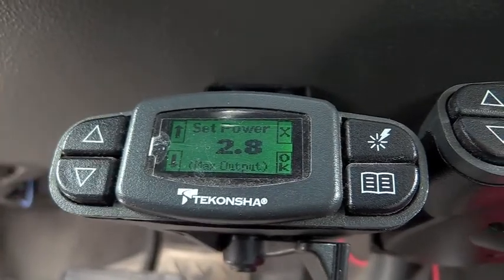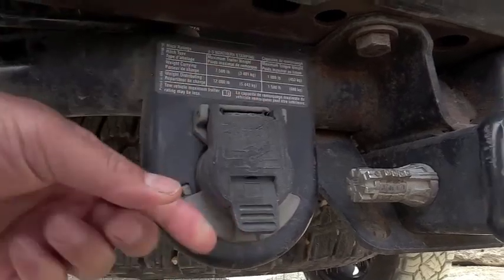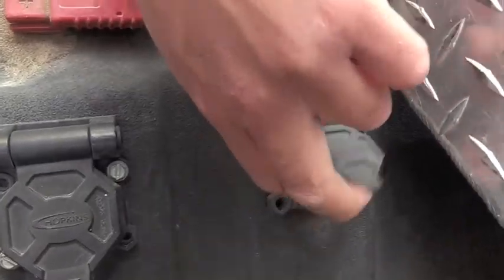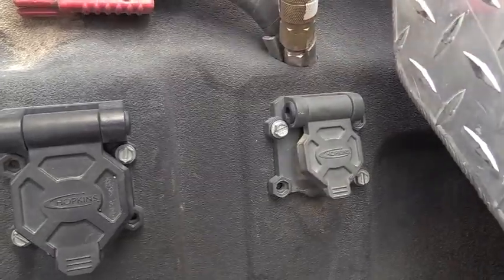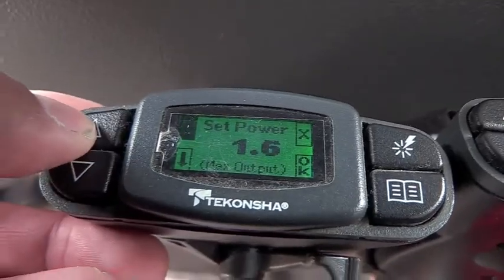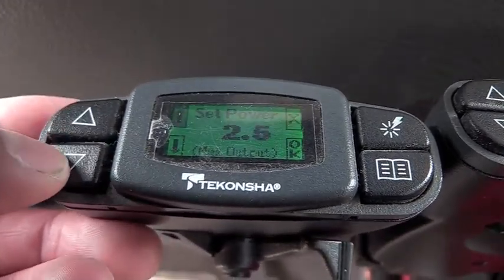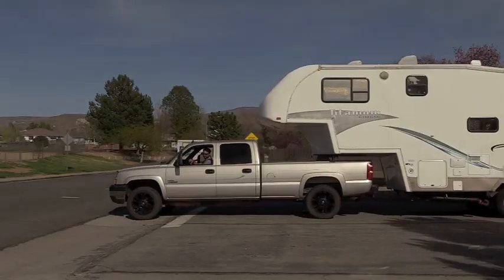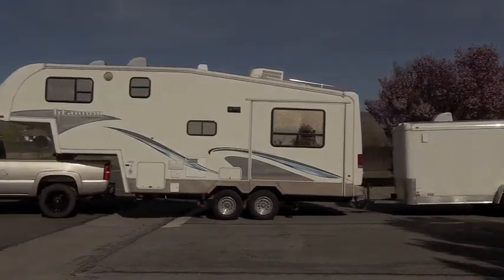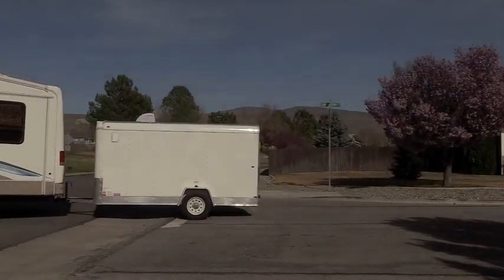To put this in different words: this brake controller is wired to the plug on the back of the truck at the two-inch receiver and to the six-round plug in the bed of the truck. The six-round in the bed is just a pass-through to the plug on the back of the fifth wheel. So all three of these plugs are connected to this one brake controller — essentially it's for any ball-hitch trailer we are towing. The other brake controller is dedicated for any fifth wheel or gooseneck trailer we would be towing.